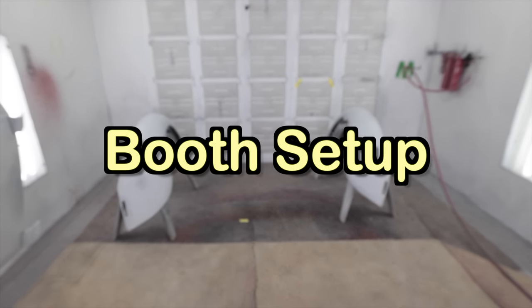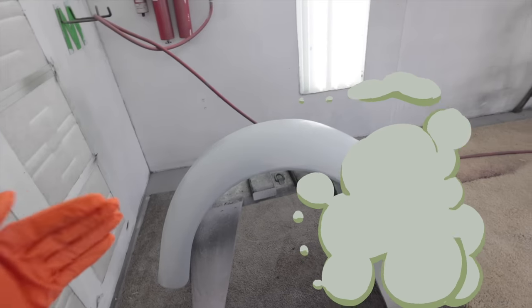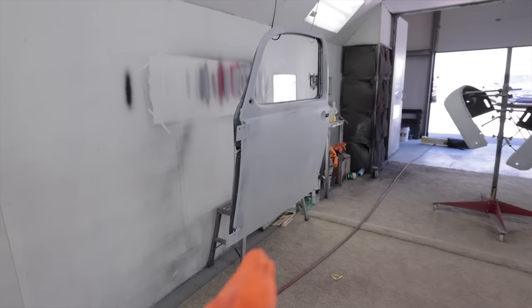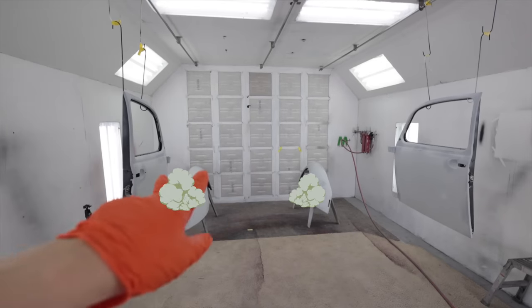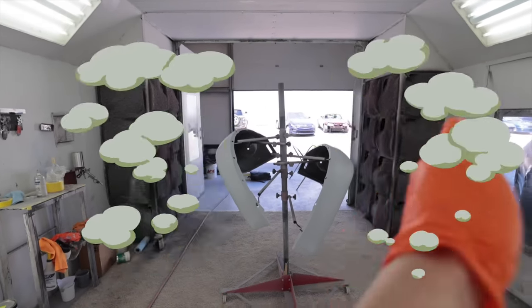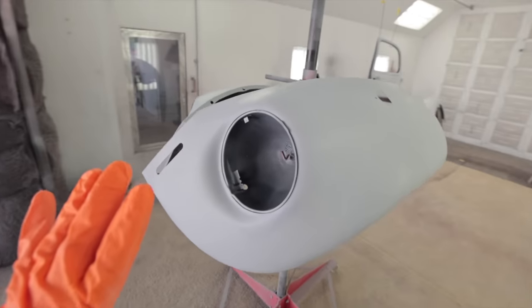So there's a method to staging everything here in the booth and why I'm doing this on two separate days. I have two of the rear fenders right here at the front by the intake filters and they are turned sideways so I can shoot them - the overspray is going to flow out this way. Notice the doors are sideways, so it gives little surface area for overspray to stick to. Those are mounted hanging up and taped to the hooks so that way they can't rotate and accidentally smack the back side of the door. The last two fenders are in the middle and the exhaust filters are right here, so the airflow naturally takes leftover paint particles away for minimal overspray on them.